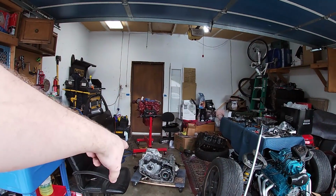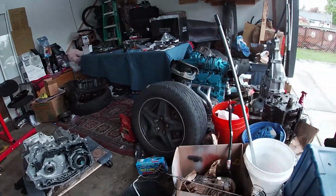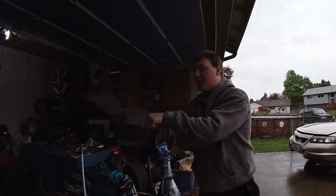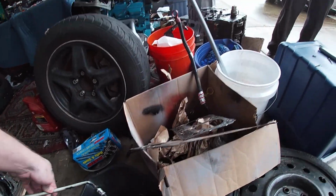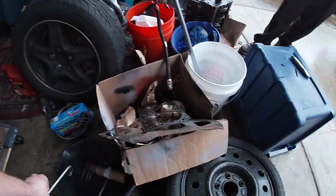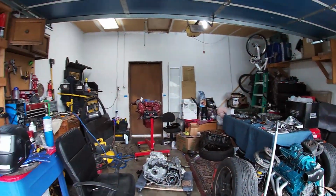Those still have a fitting on it. We just removed the line, and we would need to replace the line anyways because they were cracking. So now with what you said, we can buy those lines exactly how they should be off of Rock Auto for super cheap. Basically it's these metal lines that just fit in there, and then past that you've got rubber. So you can still make it work. It's just not as simple as putting AN lines on it.